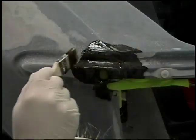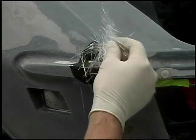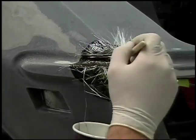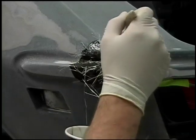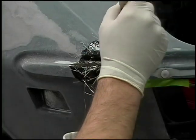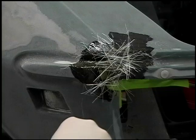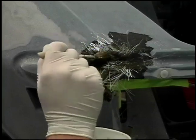The resin itself bonds to the fiberglass and then we start laying in strands of fiberglass. As opposed to using a sheet of fiberglass, the strands will attach themselves individually to the existing fiberglass. You get a little bit better repair, especially for a small crack, and you don't get as much fiberglass build. It's really important to keep putting resin on using the brush, work in the fiberglass, put on more resin, work in some more fiberglass strands, and keep building it up until you're just about even with the top.